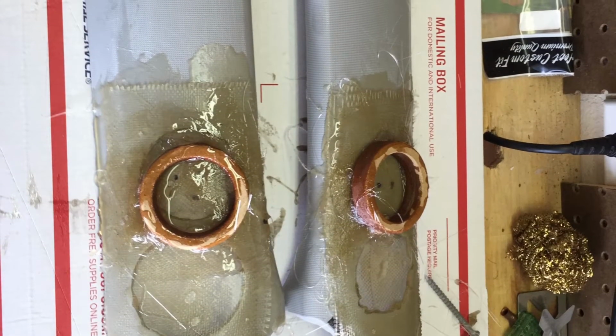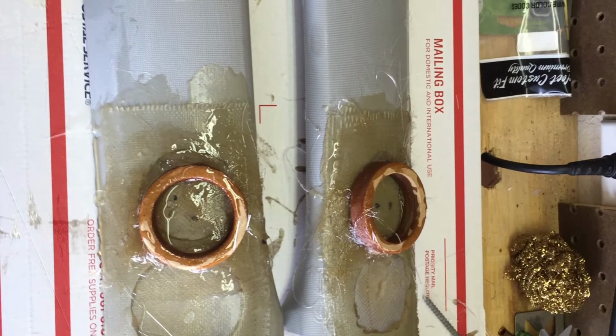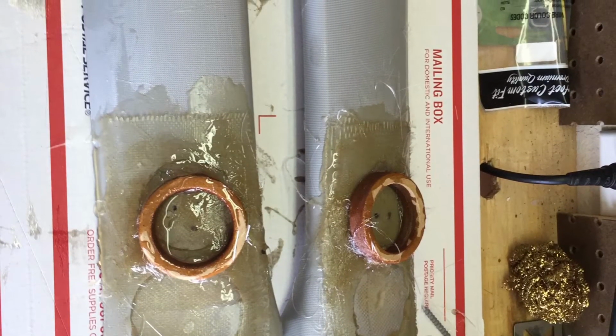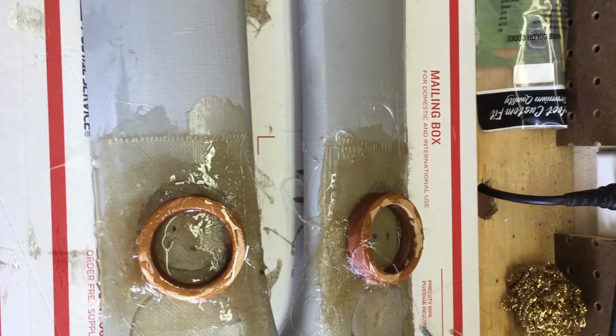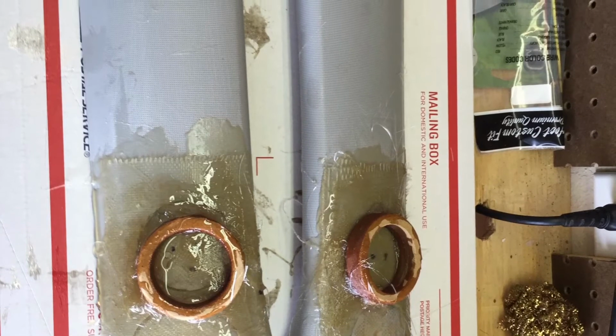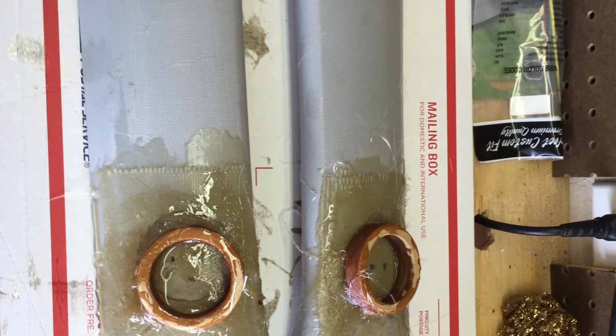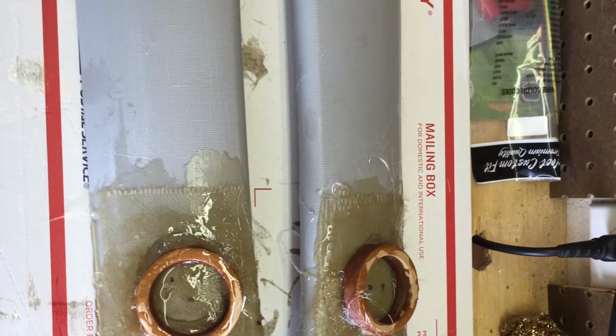Once I got the MDF rings in the place that I wanted them, I took my hot glue gun and glued them in place. Once that was done, I could take the resin and bond them to the patches that I had already created. If you need to learn more about how to use fiberglass, I'll add a link in the description below for my center console build where I go into much further detail on how to do that, how to mix, how to use it.